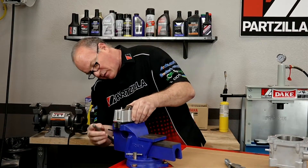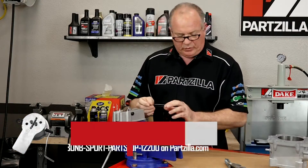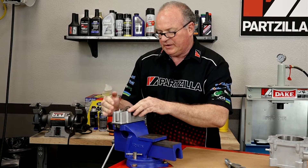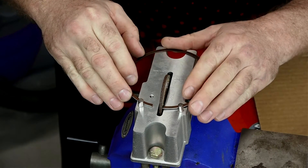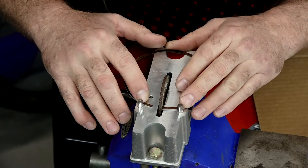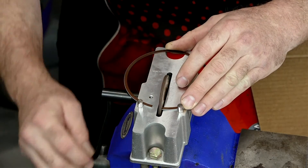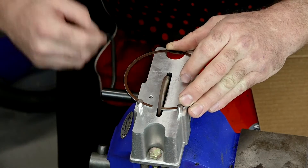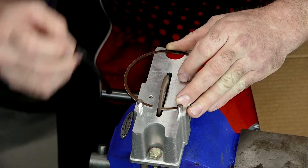Let's grab our ring gap file, get it mounted in our vise, and then we'll get that turned down. It's important to make sure that you've got it squarely against the edge — you don't want it angled like this or like this, it needs to be square up against it. We're using these two pins as a guide. It doesn't take a lot of pressure and here's where you need to be patient. I'm applying light pressure into it. We'll do roughly 40 turns.